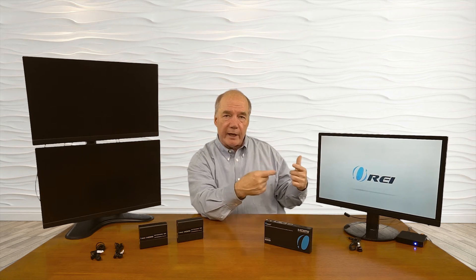Now I'll show you the connections you'll need to make to use this product with your own equipment. For this demonstration, on this side of the table I'm simulating the primary location — it's wherever the media content is that you'd like to share with the remote locations. Right now I've got a monitor connected up to a small media player, and I'm looping a video — that's the content I'll actually distribute to the remote locations. On this side of the table, I'm simulating two remote locations. I've got two monitors set up and two receiver modules. Remember, these can be up to 100 feet apart, as long as they're within 100 feet of the transmitter. The first set of connections I'll make are to the transmitter — I'll disconnect the media source from the monitor, take a standard HDMI cable, and plug that into the HDMI port on the back of the transmitter. Now I'll add power to the transmitter — I've already plugged the power supply in, I've got a barrel connector here, and the minute I plug this in, the LED goes blue and then it goes red.